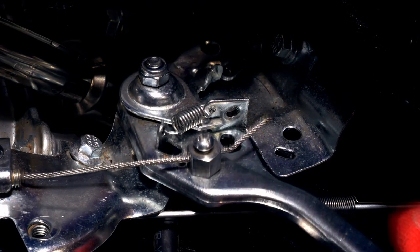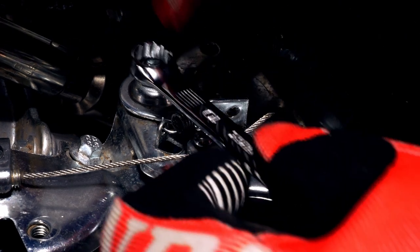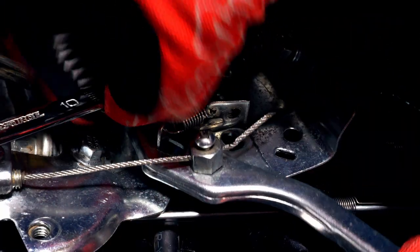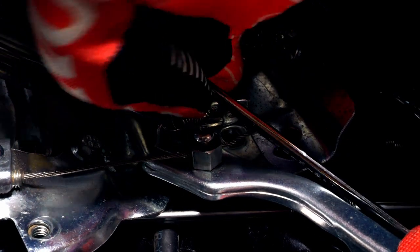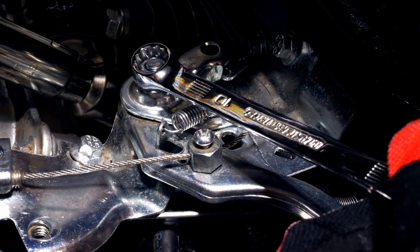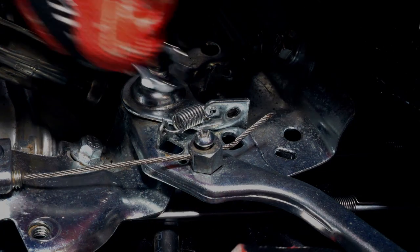The other issue I'm having is that this part is jiggling like crazy. This lock washer was obviously just thrown on from the factory — I ended up doing quite a few turns to tighten it back down originally. You want to take one hand on the base right here and jiggle it while you're tightening, and by doing it like this you can feel the slack coming out as you tighten, so you won't have to worry about over-tightening it.